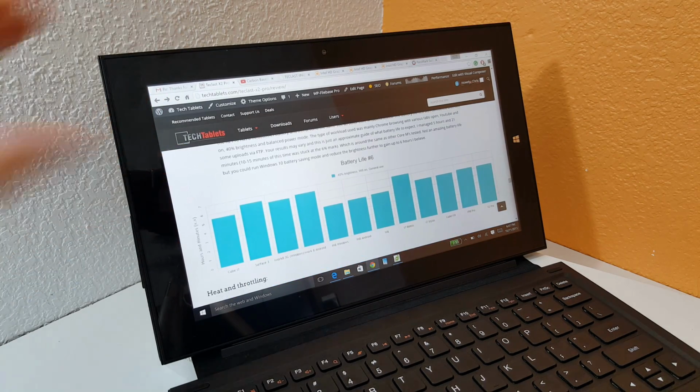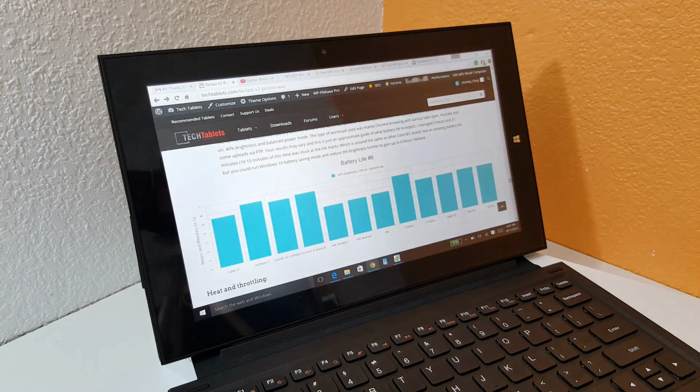Now, battery life. I finally finished my battery life test. You're looking at just over 5 hours. That was with 40% brightness, just doing what I'm doing now, so some web work and looking at some websites. Wireless on the whole time, Bluetooth's been on, screen brightness at 40%. I got 5 hours, 21 minutes, and it did sit at 6% for a little while, which normally does happen on these Chinese tablets. Sometimes they do sit on 6% before they finally power themselves off.